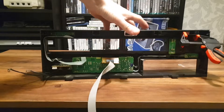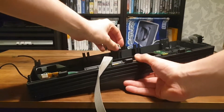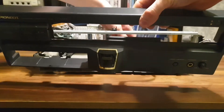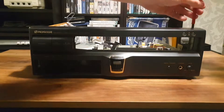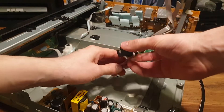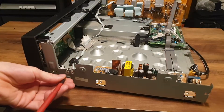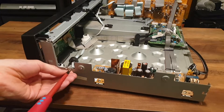It's the next day and the glue has dried on the faceplate. Removing the clamp was easy, but you can see here that the CA glue touched the rubber band and made it more tricky to remove. Another thing I fell victim to was forgetting where all the ribbon cables go. Some of them are long enough to fit multiple sockets, so it was easy to plug them into the wrong place. However, since I documented my teardown, I was at least able to revisit my footage to see where the ones I'd forgotten had gone. So if you're repairing something complicated, take good notes or pictures along the way.